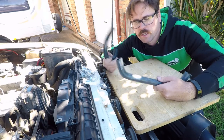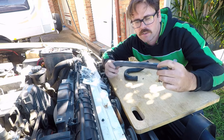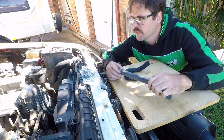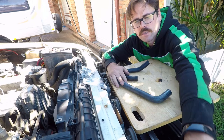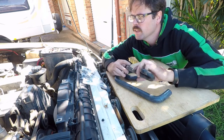So I've found the two hoses I don't need — these two. I'm not going to be able to get much out of this one because of all the bends in it, so I'll just use this nice straight section here to cut the bits I need to get the copper tubing onto the heater tap.